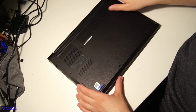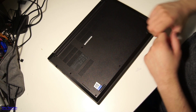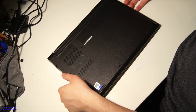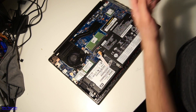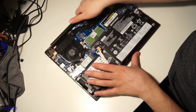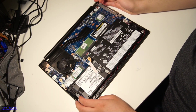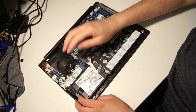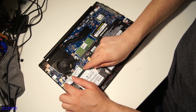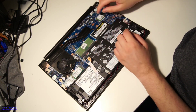First off, you're going to want to unscrew the nine screws that are holding the back cover on. There are little plastic clips that you can just undo, and the back comes off like this. I've already taken the screws out to help save some time. This laptop is actually fairly upgradable for a laptop of its class. We have a removable SATA SSD, a removable M.2 NVMe SSD that fits either 2242 or 2280 SSDs, and we have two DIMM channels and a Wi-Fi card.